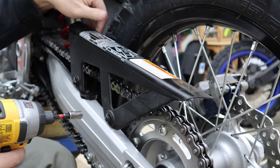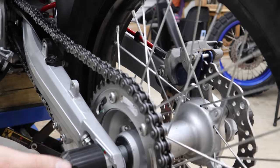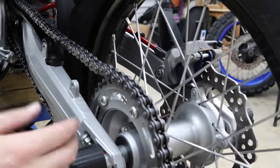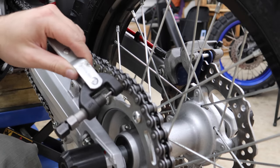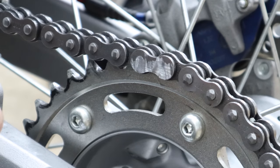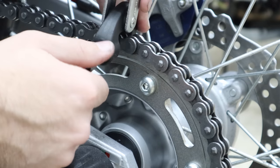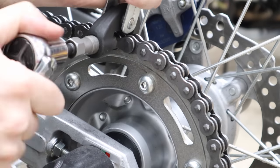I'm going to start with the rear — let's knock this out. To remove the chain, roll the wheel around and look for a master link with a clip, but if your bike has never had the chain replaced and has the OEM chain, there may be no master link. The chain breaking tool won't work on full rivets, so what we need to do is grind the heads down on two of the rivets. Then clamp the tool on tightly and push the pin forward to force the rivet out the back side.